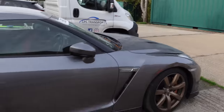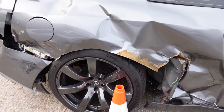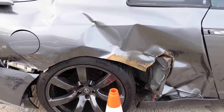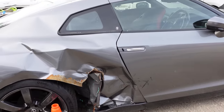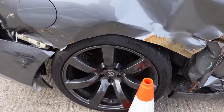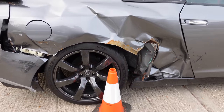In the last video you'd have seen I rolled it off the back of the trailer and it came down with quite a bit of speed and ended up hitting the tyre that I put there, and the back wheel kind of bowed out a little bit. That's fine for going backwards but when I try to push it into the workshop this wheel is going to end up pointing out because it's missing an arm. I don't want to risk driving it in because it's automatic — not like the Porsche where I could control it off the clutch. Without any brakes it's going to be difficult, so ideally I want to push it. I've ordered and collected the adjustment arm which will go in this gap here, which will straighten the wheel out and make it solid so we should be able to push it into the workshop. That is step numero uno.